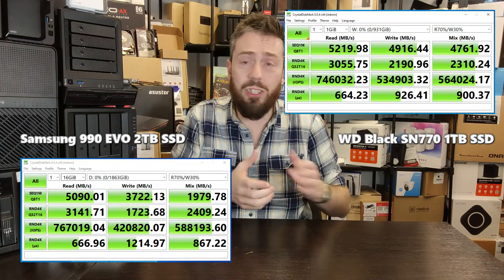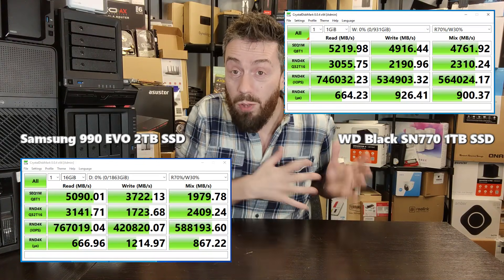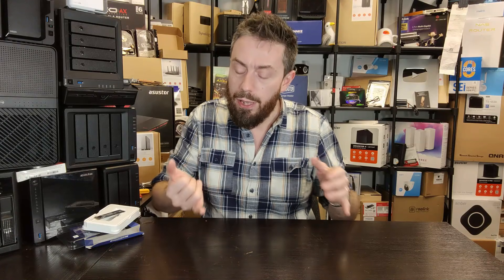One of the biggest counter-arguments against DRAMless SSDs is performance, but the reality is more nuanced. If you're prioritizing read performance, you're actually not going to be too badly off. Across Samsung, WD, Seagate, Toshiba, and Crucial, read performance on DRAMless drives is generally quite respectable — because read is simply accessing what's already on the drive, with the controller managing indexing via host memory buffer. For things like booting an OS or read-only databases, DRAMless SSDs are actually pretty good.